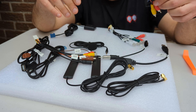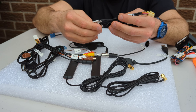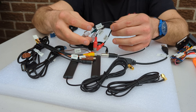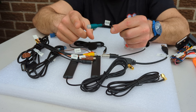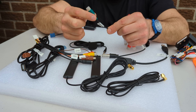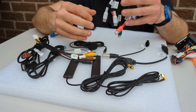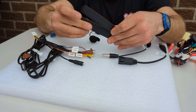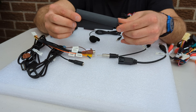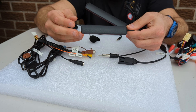The first thing you're going to notice is the stereo harness. Depending on the variant of your Jeep Grand Cherokee, you might need to connect the red and white RCAs to the AUX-R and AUX-L of the female RCAs that you received. In addition to that, you're going to be installing the yellow one for your reverse camera to the brown one labeled CCDV — you just simply plug it in. You also have your main power wire for the unit and then this little white one that connects at the back of the unit.